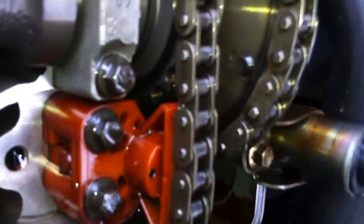These are my tensioners and just visually inspecting them they look perfectly fine. You can see that my tensioners are the second generation plastic ones and they are in perfectly good nick. There's no cracks in them at all, it's not loose, there's no give in that timing chain - neither timing chain. This one you can kind of move side to side but I'm guessing that's expected.